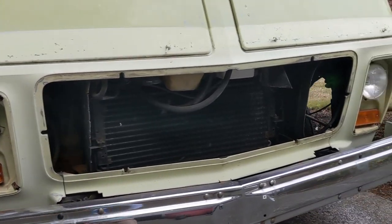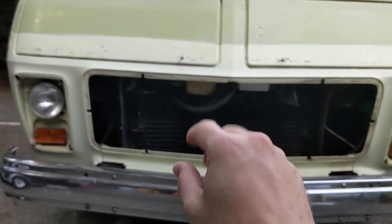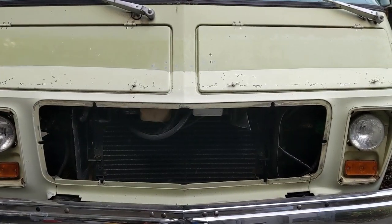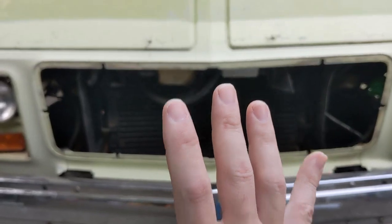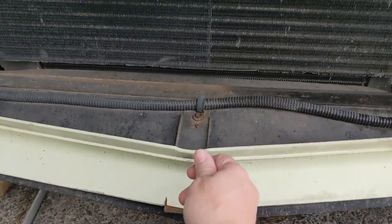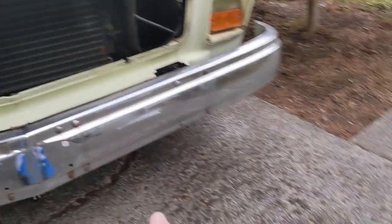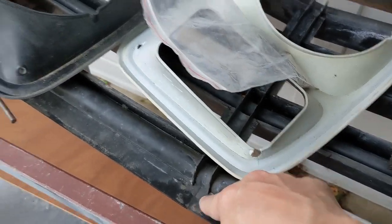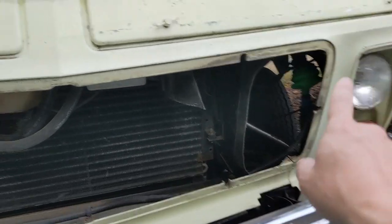You guys remember when I was dealing with the chipmunking here on the side - we're still dealing with that same issue. The motorhome is settling kind of down to the front; this whole portion is cantilevered off the front of the frame. All of this fiberglass - or I should call it sheet-molded compound - has slumped over time. As it slumped, this point has been pushed inward and flattened out. In order to sharpen that point back up to where the grille will fit - because the grille has cracked because of the stresses of that flattening - we need to get the shape of the motorhome back to where it matches the grille. We need to pull that side to that side, and that is what the cable is for.